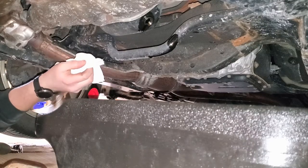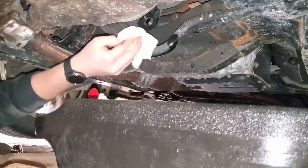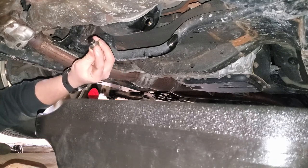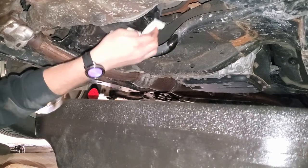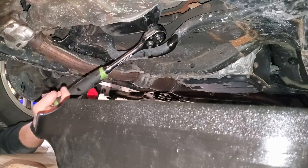After the oil has drained, you're going to have a little bit of residual, which is fine. Go ahead and just clean up that area with a paper towel, and go ahead and reinstall the oil plug that you cleaned up. I can't stress enough — make sure you have that washer on the outside. After you hand tighten it, go ahead and give it one more little cleanup there and tighten that up a little bit more.